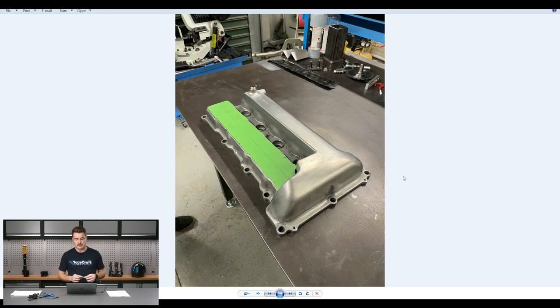Jimmy's been working away mounting this. You can see here this is the template he's made for the flat plate that's going to go on top, and then he's going to weld a whole section of bosses so each one of the coils will be mounted along the top of the rocker cover. He's got a nice tricky technique where he uses masking tape to go around and cut around the shape, peel it off in one go, and transfer it to a piece of paper, cardboard, or directly to the material — in this case aluminium sheet — which is going to be welded on top of the rocker cover. By the end of today he should have that rocker cover finished up and we can start getting those coils mounted.